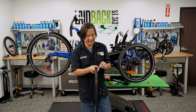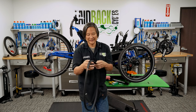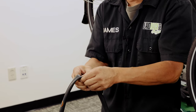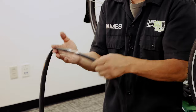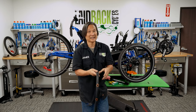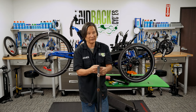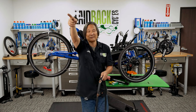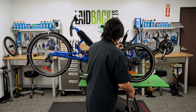I know everybody's standing around asking 'are you done yet?' but it's best not to rush this. If you put the patch on while it's wet, odds are it's not going to bond correctly. Five minutes later, once it's all dry, the patch just goes over — and as soon as it makes contact, it's already bonded. Just rub it in really well. This is a permanent fix — it bonds and becomes part of the rubber. There are quick patches where you just slap them on; those will work short term, sometimes long term, but it's really a flip of a coin. Quick patches are really a race thing — racers can't wait five minutes, so slap it on and go. Then the tube goes back into the trike.